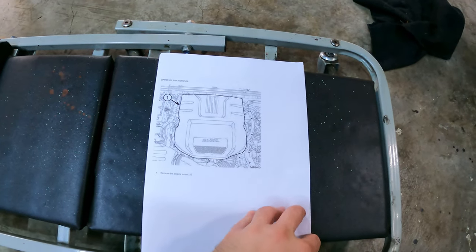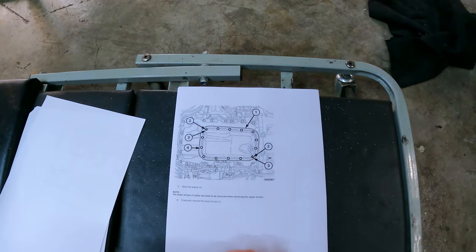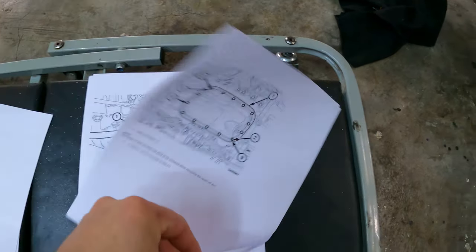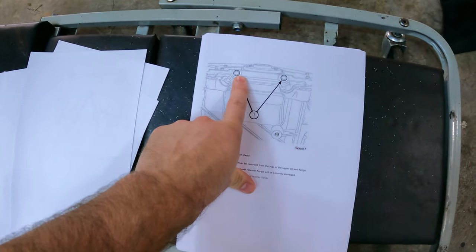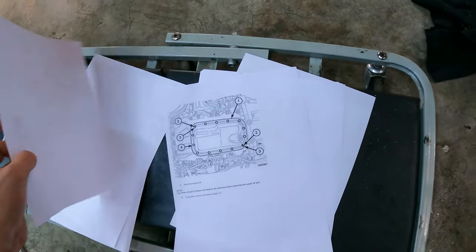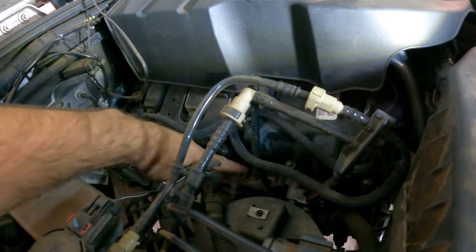When the man is about to get serious, he uses a manual. I've got this manual and I'll share a link in the description. It tells you exactly what to do to remove the upper sump. Some steps they say aren't relevant, but this will help you find all those small bolts. You need to loosen the hanger bolts — if you don't know where they are and you try to pry it off, you'll damage something.